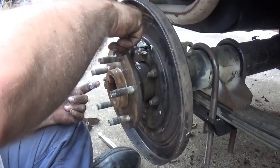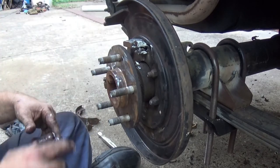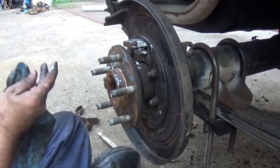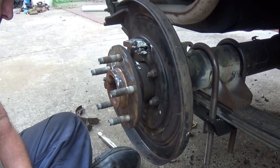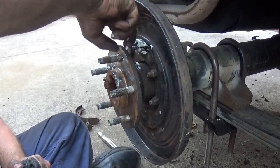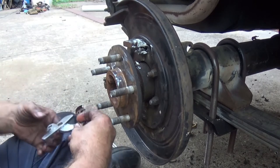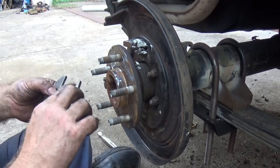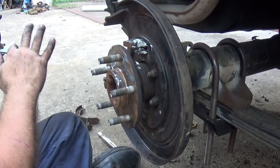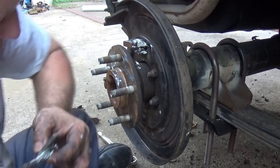I really prefer white lithium grease — it seems to be much more water resistant. Any extra grease you've got, put it on the face right here so when you slide your rotor up on there, that white lithium grease will prevent that rotor from being stuck and seized up on there. It'll help you out later when you do your servicing. Put a little dab inside the groove right there — that's gonna help it go through that boot easier and be less likely to damage the boot, and also give it a bit more water resistance to help seal water and such out.